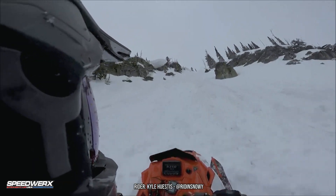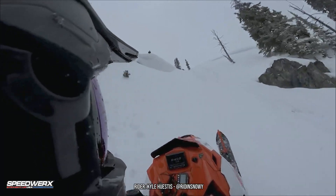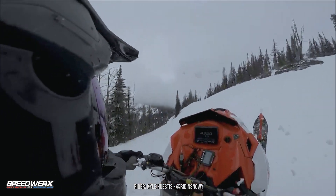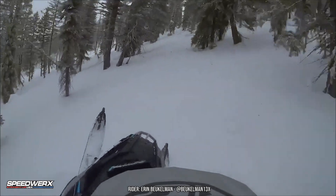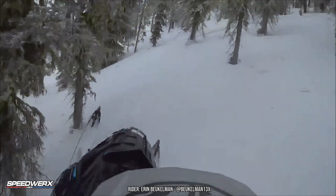Our intake temps are so low. On average, on a 20 to 30 degree winter day, you're going to see 60 to 80 degree intake temps, which is really low for a boosted application at the boost levels we're running. It just makes everything better — when you squeeze the trigger, it makes it that much more fun. It makes it easier for us to map and control everything, and it makes it run better day in and day out.